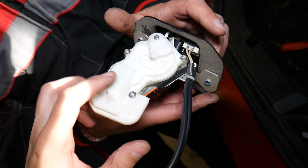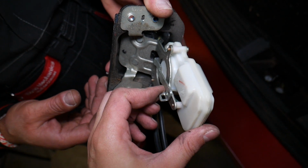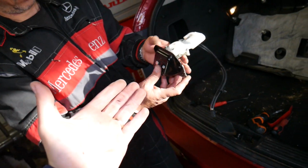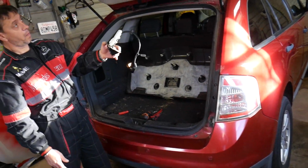That plastic mechanism sometimes will break. It has a plastic gear inside that opens and closes, and if it breaks, it's pretty much a done deal. So that's how you remove the trunk lock actuator. If you need to get a replacement one, we'll have the link in the description of the video below. Hopefully the video will be helpful. It should work on Ford Edge and Lincoln MKX for this generation.